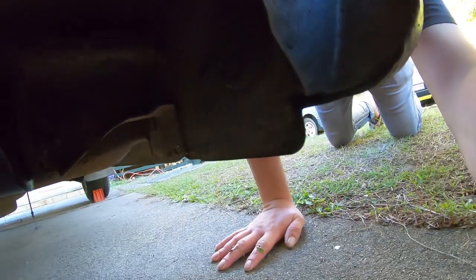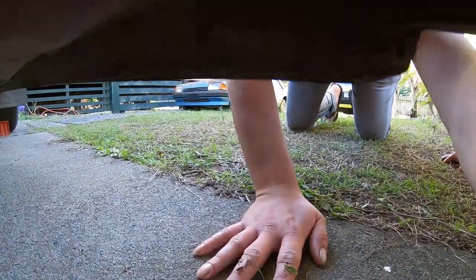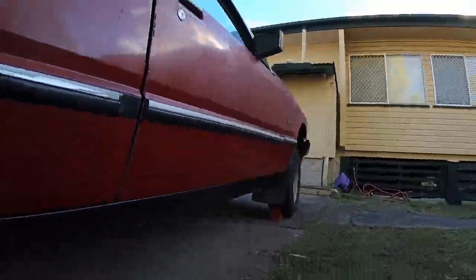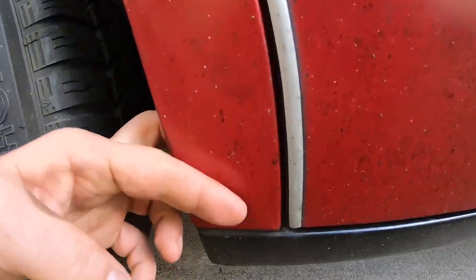If you look from the back or the front, get your eyes level with the panel and get down close. You almost capture the sheen — if you can — to look for any repairs or interventions. This looks like it's all dead original, perfect seals. While you're here, check the dogleg — look around the back here, check the dogleg on the inner.